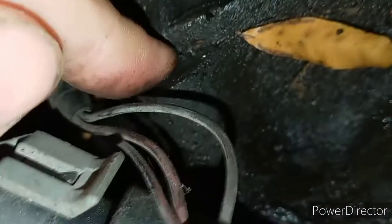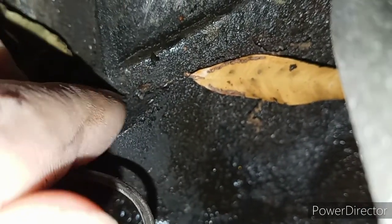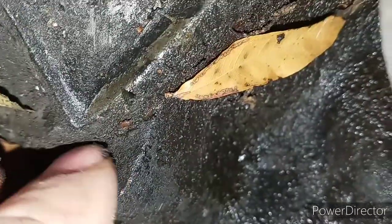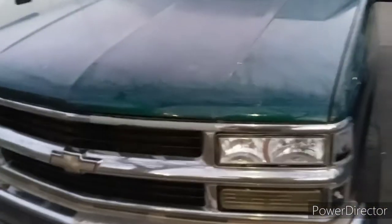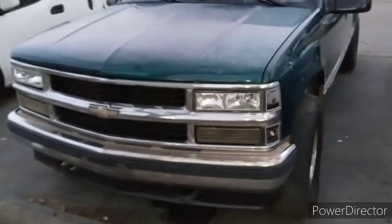It's in such a tight spot — you go back here behind the distributor. You guys can see my finger right here. So that spot I just showed you guys on the back of the engine block, below the distributor — if you have a spot that's flat and smooth, capped over, then it's a two-bolt main.